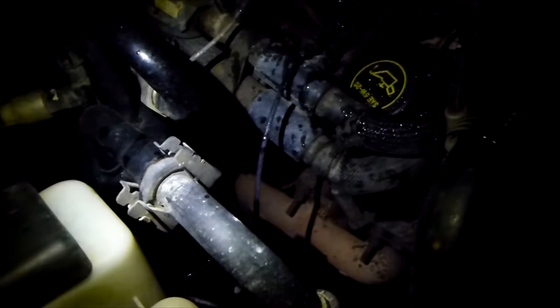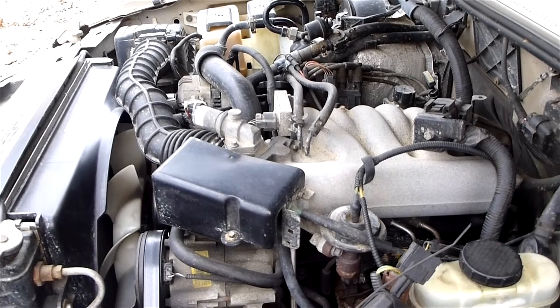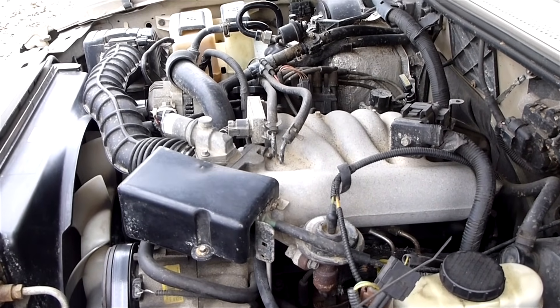So you get the idea. Right now I'm spraying on top of the distributor cap area. Now I'm moving over to the passenger side wires underneath, where the wires meet the spark plugs. I don't see anything there. And now I'm moving to the driver's side. I don't know if you can see it sparking in the back there, but they're sparking — just little flickers of light. And now I'm going to try underneath. I don't see anything underneath. So you just saw the water mist test, and you saw it did spark, so there is arcing.